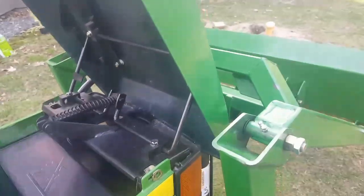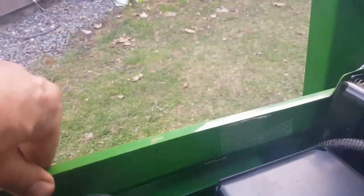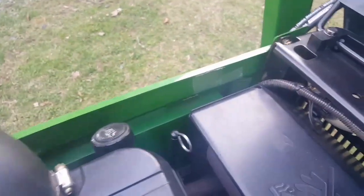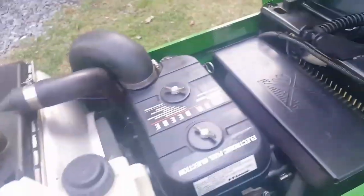Turns out that my right panel's never had cracks, but I had a ton in the left panel. In fact, you can see right there where I've done it on this one, just there, but I've got more all the way down there. I did it again, same technique, using this drywall tape and E6000. Works a charm, very inexpensive. It adheres to the plastic, which is the most important thing with adhesives. Obviously, I've only got a couple of hours on it, testing it, but I don't see it falling apart. I think it's going to be great. So that worked out very well.